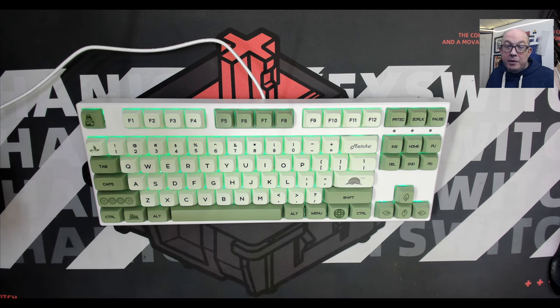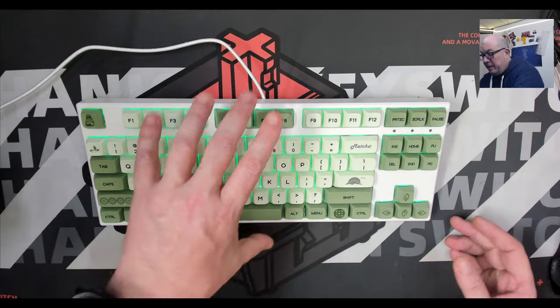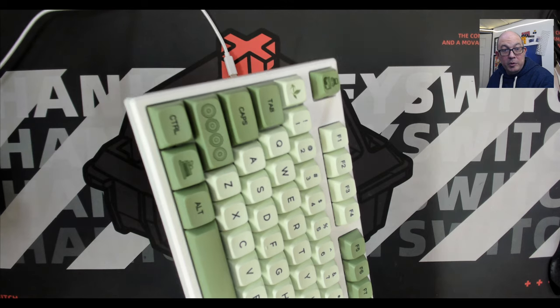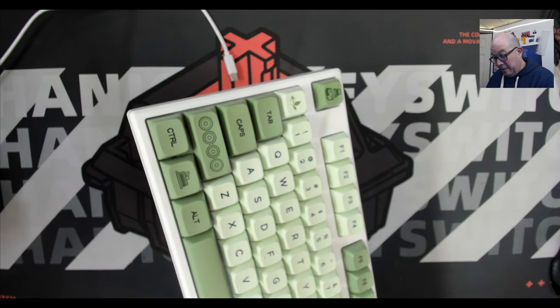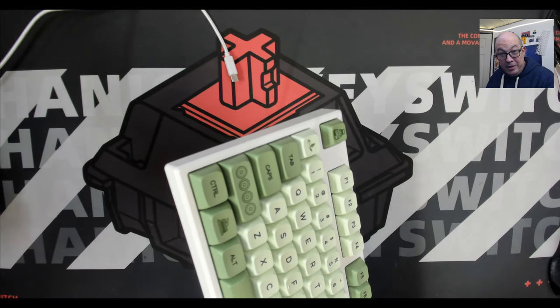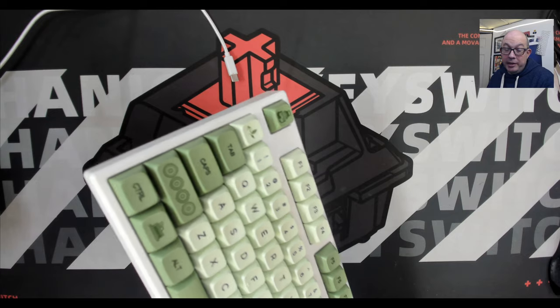Saying it has pro software and not having a link to it anywhere — not even on the official boyekeyboard.com — I just don't get it. I'm afraid this keyboard isn't going to sound the greatest, though not the worst. The 1.4mm keycaps are making a difference, but had they put better switches in and some dampening underneath, that would have made a big difference. With a PC plate, I think this would be worth $120 fully built with good switches and good keycaps.